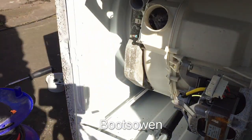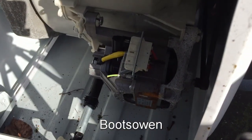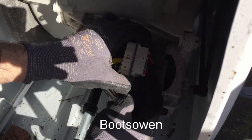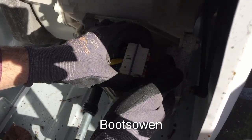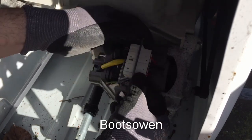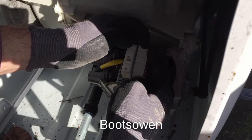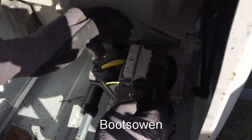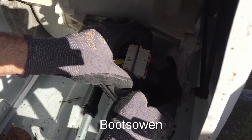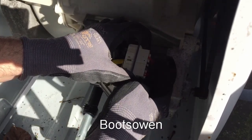I've got the machine over on its side. I want to have a look at how to wire this motor. I've stripped out all the cabling and the pump so there's a lot more space in here. I've got six cables here on the connector block — two little red ones which I believe go to the tacho because I can see them down here, a grey, a black, a brown I think, and a red.